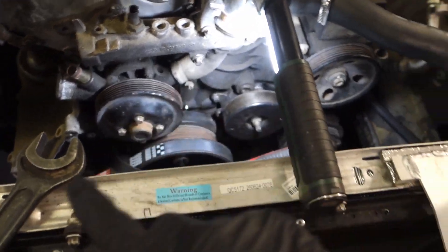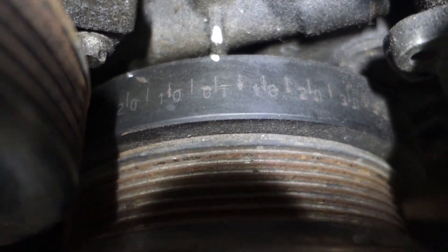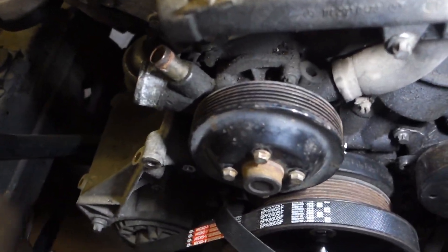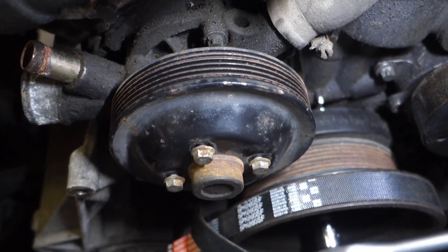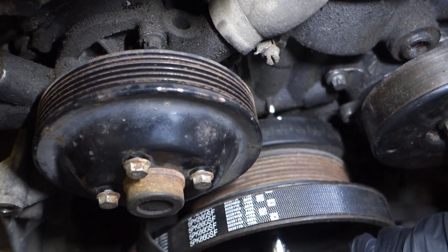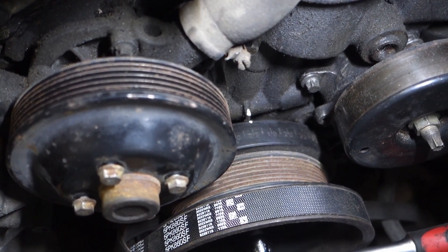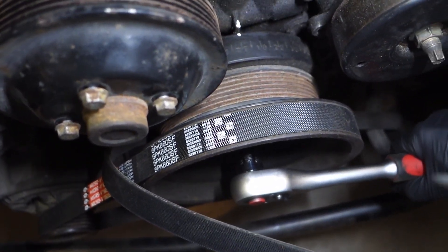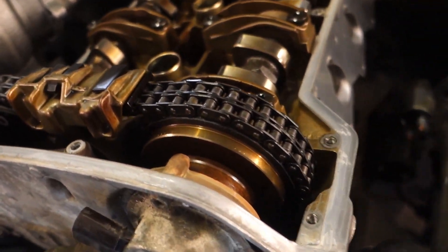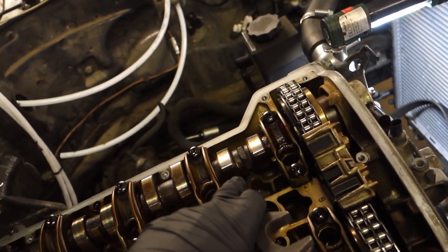So let me show you how to correctly set timing without any possibility of failing. Turn the crankshaft clockwise until it's on TDC. I've highlighted the TDC mark so it's easier to see. Here is one critical thing that applies to any engine when setting timing: if you're approaching TDC turning clockwise and you go over by accident, you cannot just turn the engine anticlockwise and stop there — your timing will be wrong because of the timing chain tensioner. You have to turn much more anticlockwise until you see the camshafts move back, then turn clockwise again and stop on TDC. You cannot go over — very slowly approach your TDC.